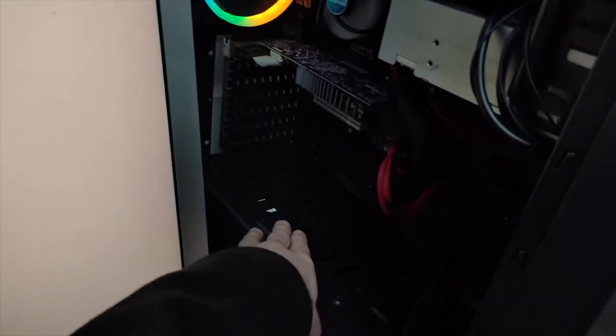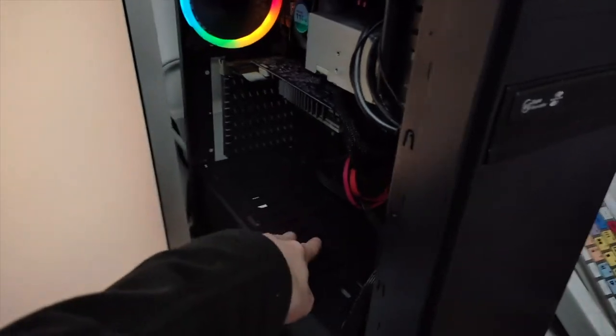This has the Windows 7 operating system, but the customer wants to wipe the data, technically, so he's having us wipe the drive, install Windows 10, install the drivers, and install a couple of benchmarks. We're gonna stress test and check the actual temperatures in this one, and maybe just do some small CPU benchmarking, to see if the power supply inside can handle it, because I'm hoping the 500 watt power supply should be enough for the 980 Ti, but then we'll find out.